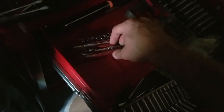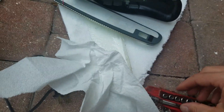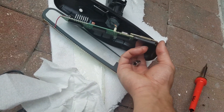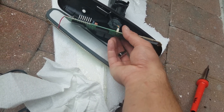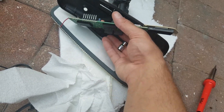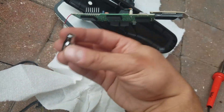Anyway, I think it was standard — that's pretty cool, they were able to fix that. You used to see this all the time on used cars: someone would get excited about a Gentex mirror and the thing was dead on them. This is just heat and vibration — it feels a lot more sturdy now. Over time it just rocks around, a lot of bumps. The other capacitors are good. We need to learn this in America, because everything's electronic now and simple cracked solder joints will screw you.